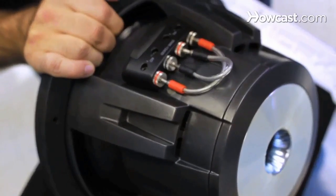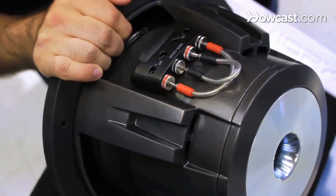If you're using two subwoofers or one subwoofer, you'd have to buy different types of subwoofers and stock four different ones in your stockroom. As a car stereo shop, this means we can stock one or two different types of subwoofers instead of five. Dual voice coil subwoofers are also typically more robust and can handle more power because they have two voice coils.